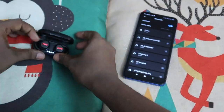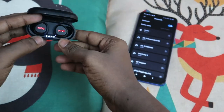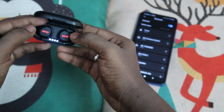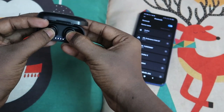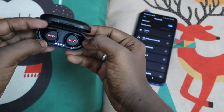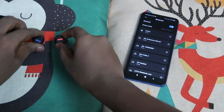Once you've done these steps, place both earbuds back in the charging case. If your charging case has battery, the earbuds will blink. If the charging case has no charge, press and hold the button on the charging case until the light flashes. That's it — the reset process is now completely done.